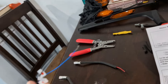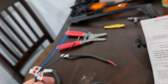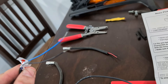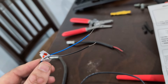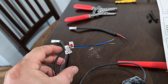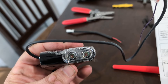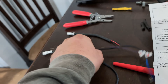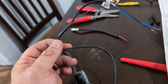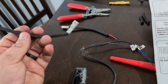So here's basically what's going to happen. Ryan wants to turn his Saber lights into turn signals. He's going to grab some additional wire, branch them off, and run them to the wiring on those Chinese knockoff saber-tooth lights. He's eventually going to get a triple play module, which will basically turn the Arlen Ness lights into run, turn signal, and brake lights. This has an additional wire we don't currently need, but we're not going to cut it — we'll tape it aside in case we need it for the triple play. Then obviously wire these directly into the factory connectors.